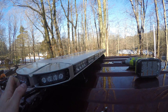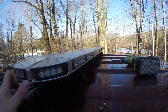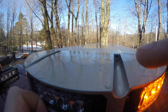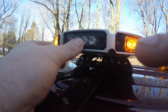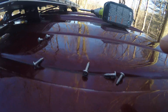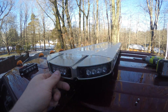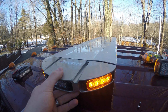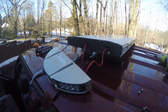So today I'm doing LED replacements. I'm going to show you how to take it apart, replace it, and put it back together. You're going to have one screw here, one screw here, and the same directly underneath — a screw there and one on the other side. These are the screws right here; I took them out just to save some time. So you take those four screws out and you take this end cap off.